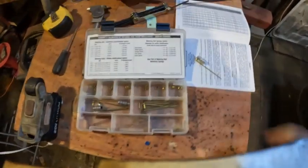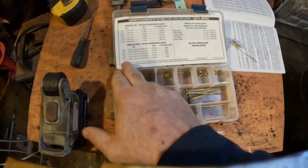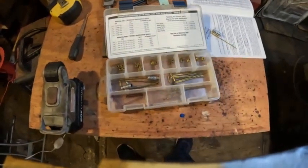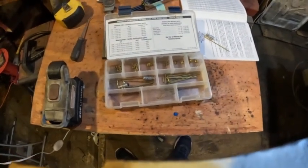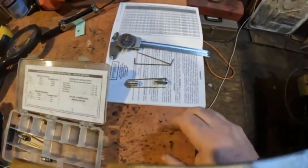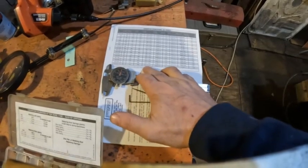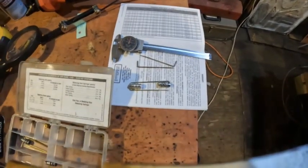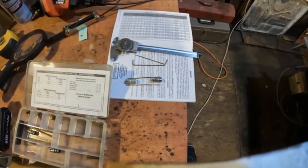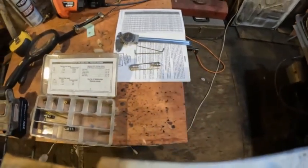What we have here is, since I have a 65 and a 52, here is one that's 73 and a 52. So if I found that one — number 1457 — I could put those in there and have the same jetting at wide-open throttle, but it would be leaner at part throttle and idle. What I was able to find is a pair of 73-47s and a pair of 75-47s. I don't have any with a small diameter 52, but I can lean out the lower RPM circuit and that may work okay. For now I'm going to put the original rod back in because the car hasn't been road tested yet, but this is a way to lean out the lower RPM circuit if needed.